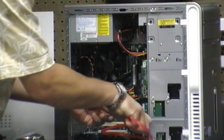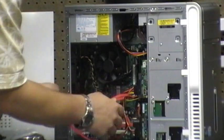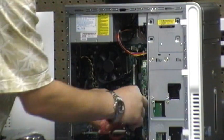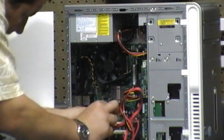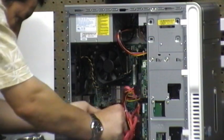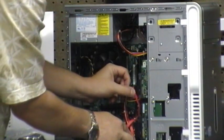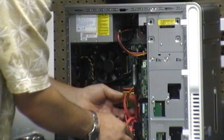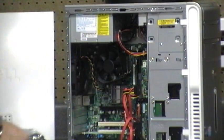Now I have all this extra cable, so what I'm going to do is just wrap it around a couple of times so there's no way it will get hot and pop around the fan. Then I'm going to pop it down here and connect it to one of the SATA ports. We've got everything shoved and ready to go. We've now just added in a drive, so everything looks good.